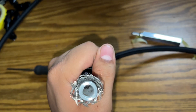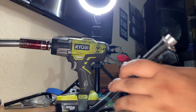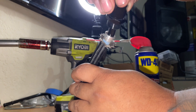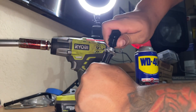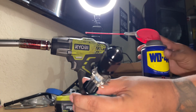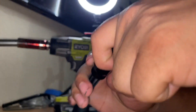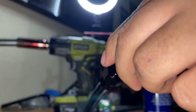Give it a quick cleaning to remove any debris before continuing. Now the WD-40 comes in — put the fitting body on top of the olive and thread it through. Spray a little WD-40 on the threads and on the fitting to get it lubricated, which makes it easier to turn. Then keep rotating it onto the fitting.